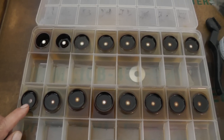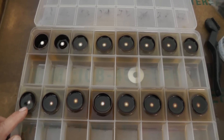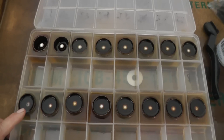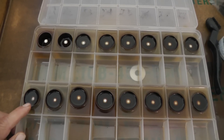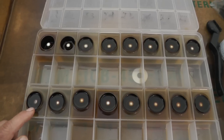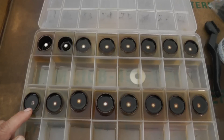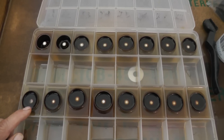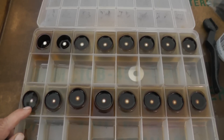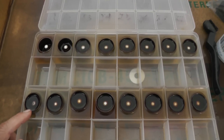What you can do is put them in engine oil, and when you get ready to put the lifters back in, basically take them out and put them in a vise where we're going to bleed them. Seems like in the old days — back in the 60s and 70s — all you heard was about putting them in oil and getting them pumped up. But nowadays the norm is to actually bleed the oil out and allow the lifters to pump up to meet the valve stem.